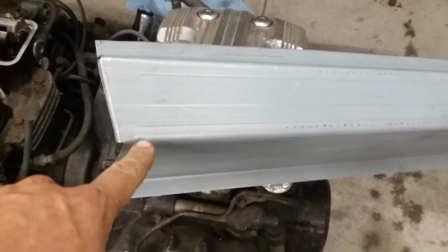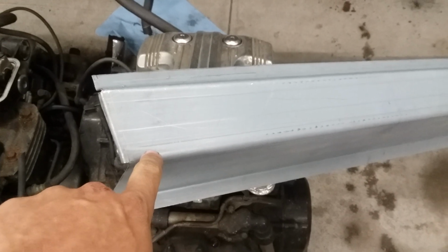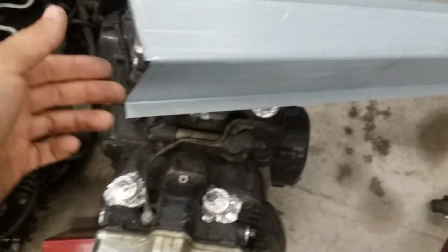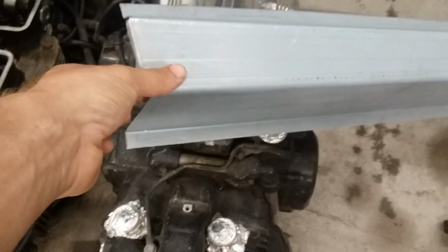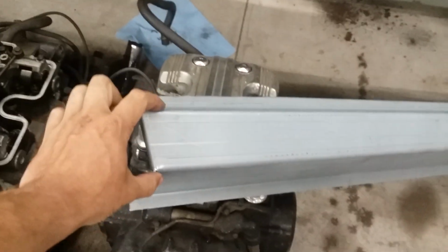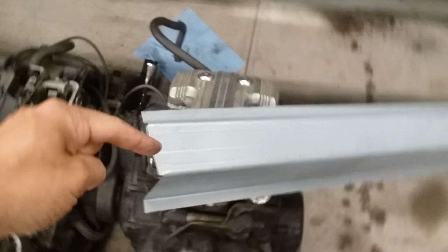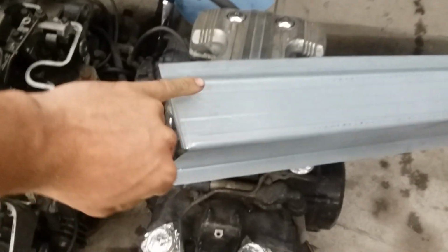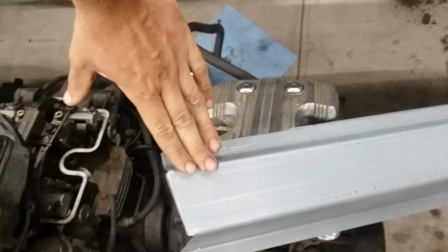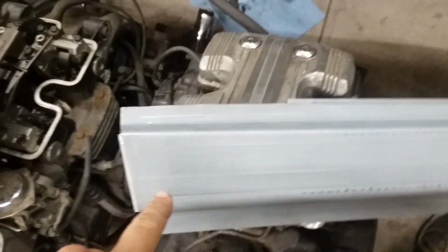And for me to take this over to my metal shop to have this done in a brake, not only would it cost me, again, $5 per bend, but their brake might not be able to fix this. I'd have to bend this back, and then I'd maybe be able to fit something in there to bend this right, because this would have to have a curve. In reality, I'm sure when you make these quarter panels, these 2 bends are the first ones you do. The absolute first bends you do, because they're on the inside. With brakes, you have to work from the middle of your product to the outside so that you can fit all your bends around the brake, because brakes don't operate with the thickness of my pinky. They all have clamps that are as long as my hand and fingers, so it makes it hard fitting things in there to bend it right. So I probably wouldn't even be able to bend this right, which is a big disappointment.